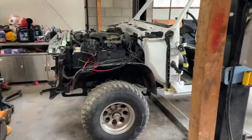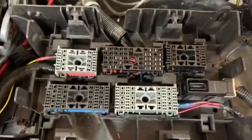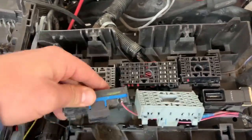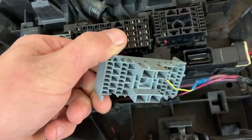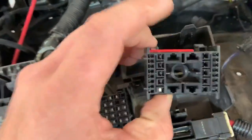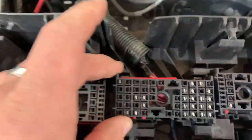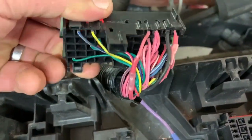I just want to show this to make it easier for anybody doing something similar. This is pretty much the wiring I had to use. This connector is just the power for the data link connector, so that wire just runs right under the dash. This connector has one pin — it's ignition power to the yellow wire, which powers up one of the relays, the powertrain relay or the run-crank relay. This one also has one pin — it's just your fuel pump output. This one has a whole bunch, but that's the harness that goes to the engine. You don't really have to touch that one too much — I think I removed a couple, and there's a lot of trial and error, but that one's pretty much left alone.